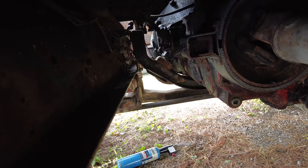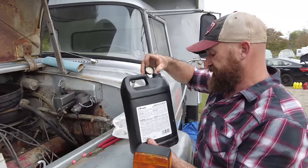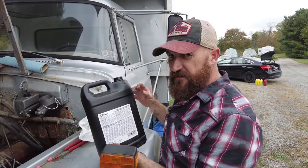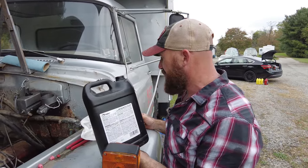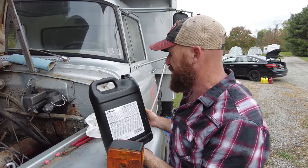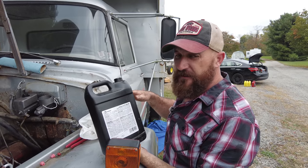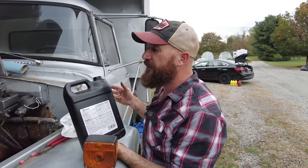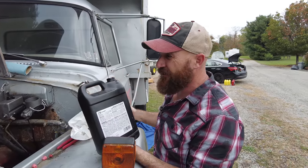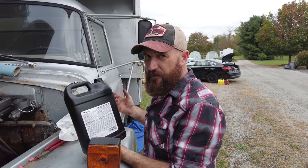All right, let's go and put some fluid in it, try to bleed it out. I'm hoping that slave cylinder down there is good, because I don't think the retainer nut's gonna come off the hydraulic line without breaking. And it's a metal to a rubber hydraulic line. I know I'm not gonna be able to get one around here. I should have brought a 1/4-inch and 3/8-inch hard line kit, hydraulic line kit. Didn't think about it. If something happened here, I could have literally just made my own hard line and replaced it with a rubber line later, and it would have been fine for the drive.